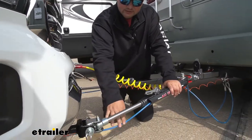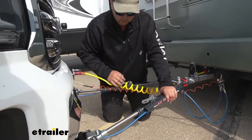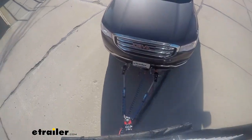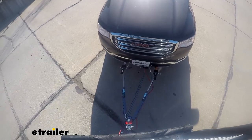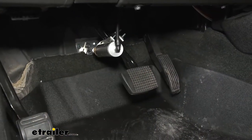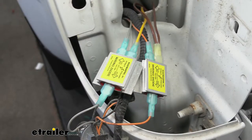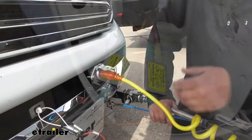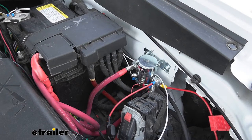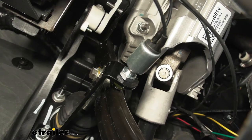We're also going to have our safety cables, which are going to save us if there ever was a disconnect to keep attached to our truck. We're also going to have our supplemental braking system which applies the brakes in our towed vehicle whenever we push the brakes in our motorhome. We also have a breakaway switch that applies the brakes if we become disconnected, diode wiring for lighting functions, a battery disconnect, and a stoplight switch.